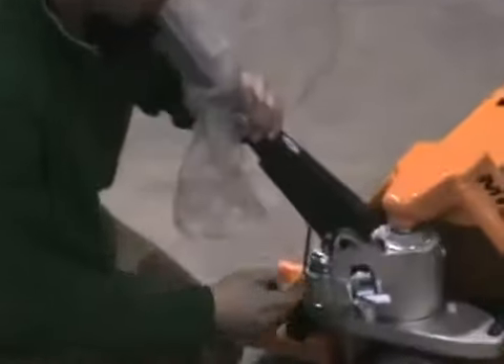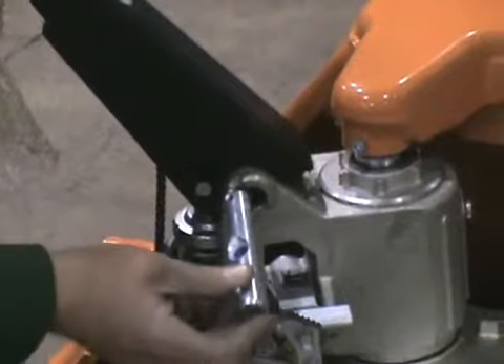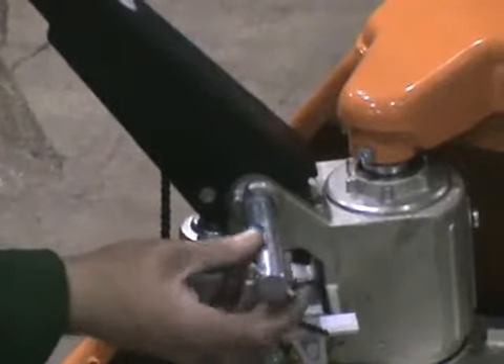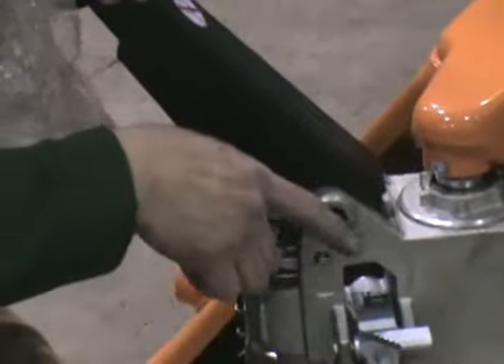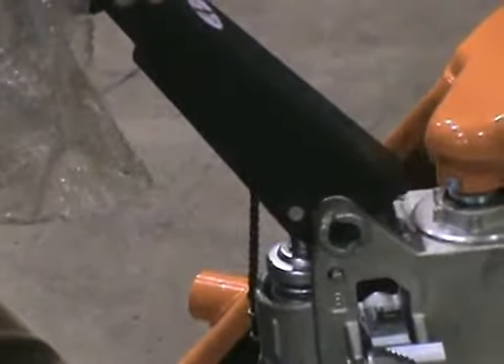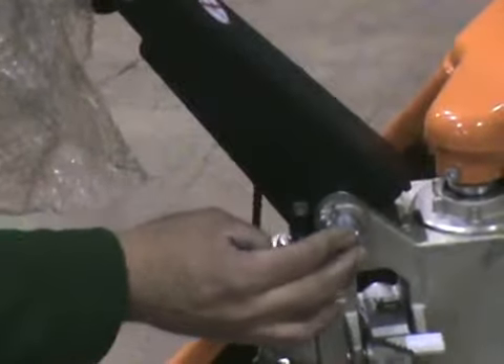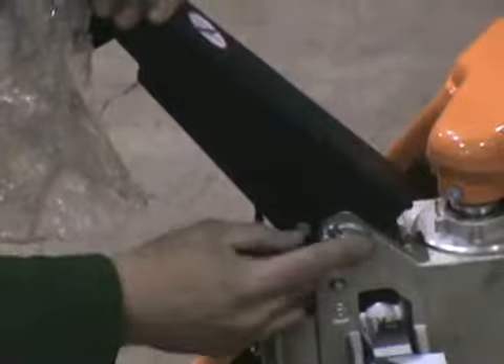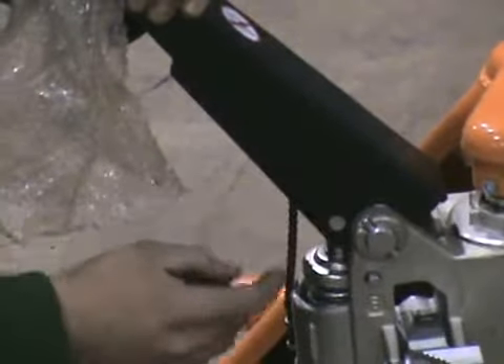You want to aim the two holes here and put your bolt back through. On the end is a fixed pin, and that will align with the notch right here — you'll know what I mean when you're doing this. Slide that in until it touches, and that will center your hole in the bolt for the chain.